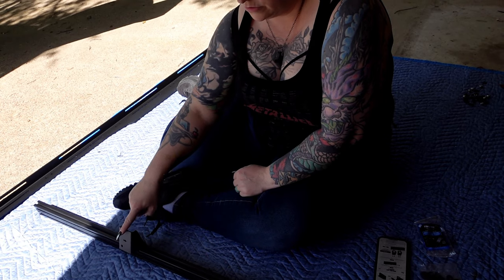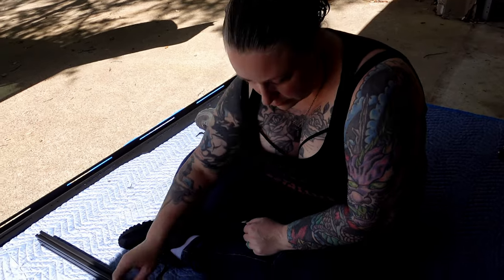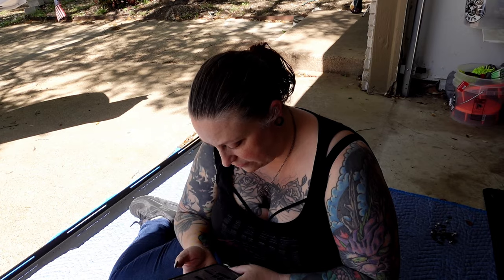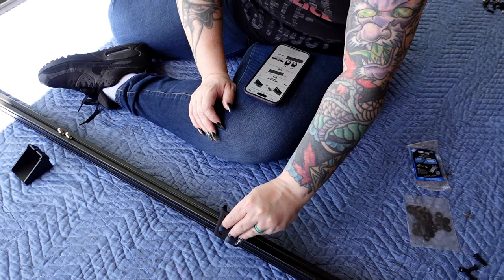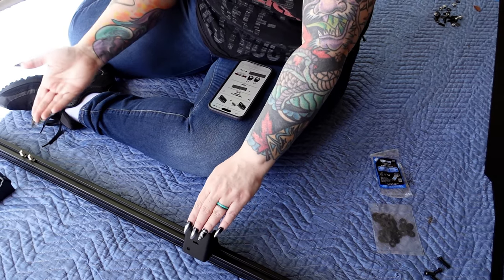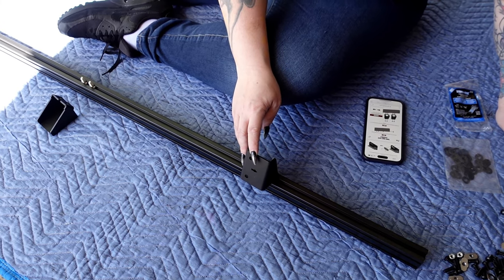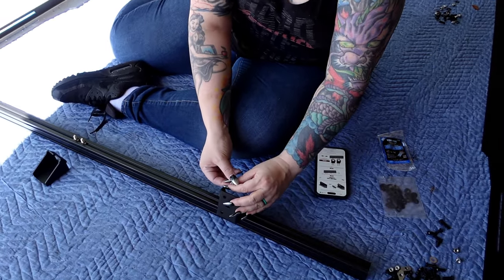The next set of instructions — we are supposed to take these carriage bolts. What's special about a carriage bolt is the underside of the bolt head is in a square shape. When you slide it into a channel, once it's in here it can't twist, which is really nice because you can't put anything on the other side of this to hold it steady. So you have to have four of those up front. These four are going to be used to hold these brackets down. The brackets go into the mounts right in front of my windshield.